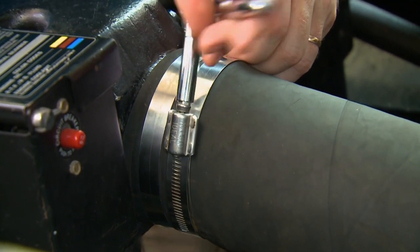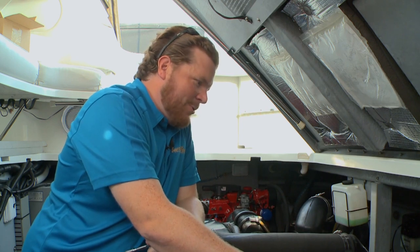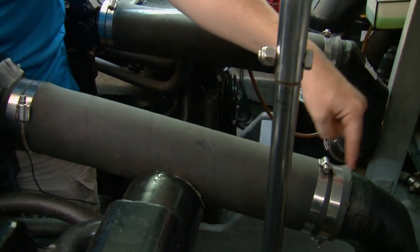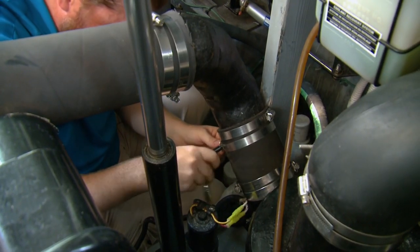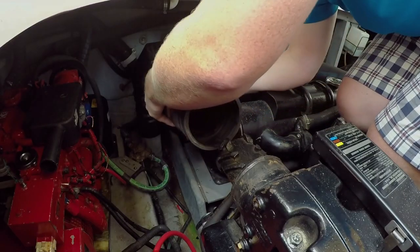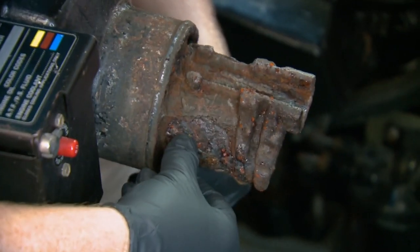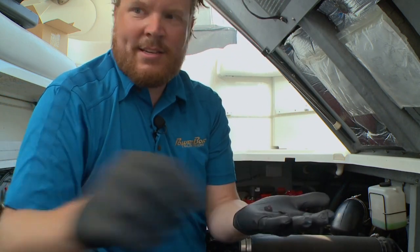Start by loosening the hose clamps. In theory you could just take one section of hose off, but from my experience that's frustrating, so instead we remove the clamps here, move all the way down, and remove the two clamps that connect into the muffler. Then we take this L-shaped section off — you can see this is badly corroded. Part of this piece shouldn't even be possible; in fact, a couple pieces fell off as we took the hose off.